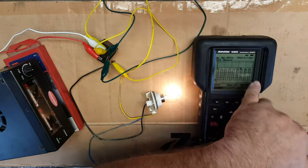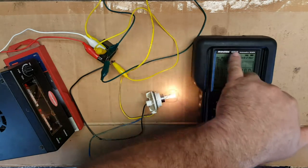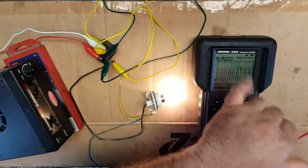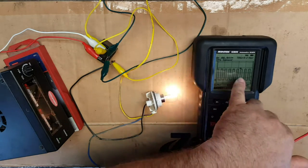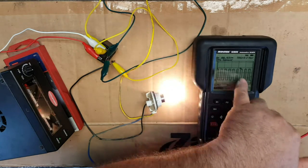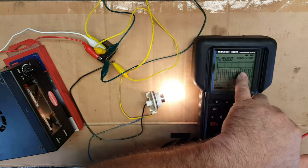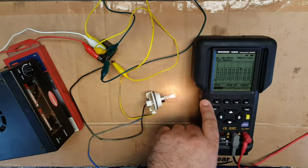Okay, see it flicking up there. It doesn't actually give us a very good read. That's what you would see on your voltmeter, is that voltage on the screen there. Flicking around all over the place, the voltmeter can't take samples fast enough to give us any kind of pattern. Whereas on the screen, we can see that. And the trigger point now is as soon as the voltage gets to its maximum, the start point is that top left-hand corner.